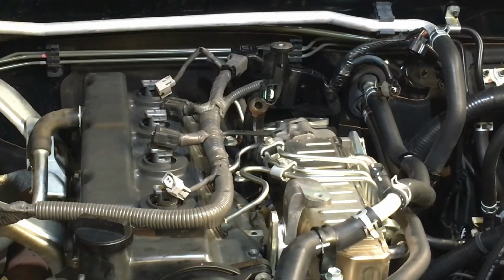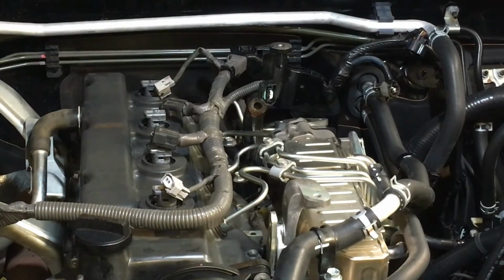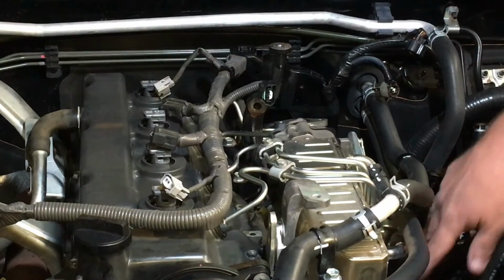That is quite hard to get to. I'm going to put it out there and say that bottom bolt on that stay is easiest to get to on the 120s, just to do with all the wiring and stuff. The 120s are the easiest. The Hiluxes are a bit fiddly because they have a different engine mount, and the corner of the steel's kind of in the way, and all the wiring loom and hoses are a bit fiddly to get to, but you just learn your ways. And the 150s, yeah, not too bad, but the 120s are the easiest to get to. So bang, they're back on.